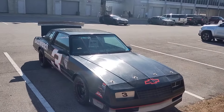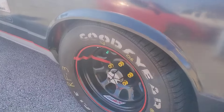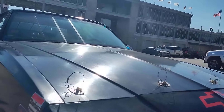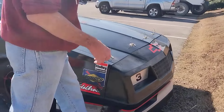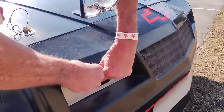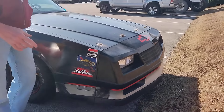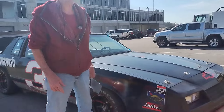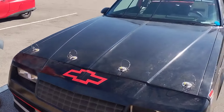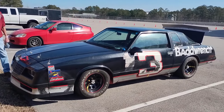The headlights are filled in. This car came with those square glass headlights with a heavy bracket and everything. I did away with that — I've got these velcroed on, so when I leave a cruise-in at night in the dark I just pull them off. These headlights are off a '95 Silverado — one piece of plastic that fits right in, with an aluminum bracket I made. The original headlights weighed about five pounds each; these weigh about a half pound each — super light.